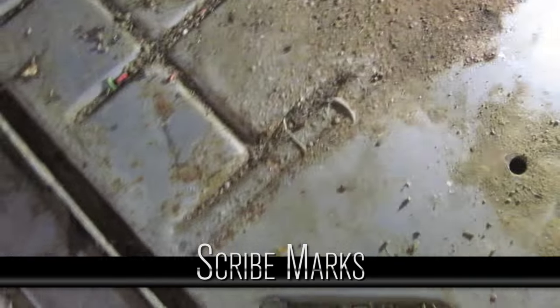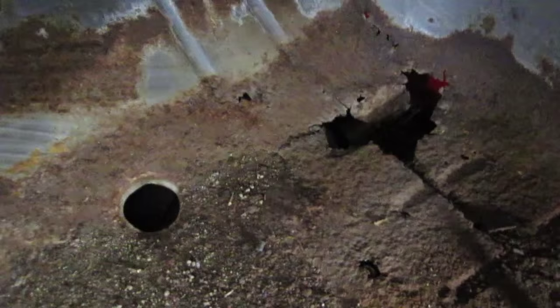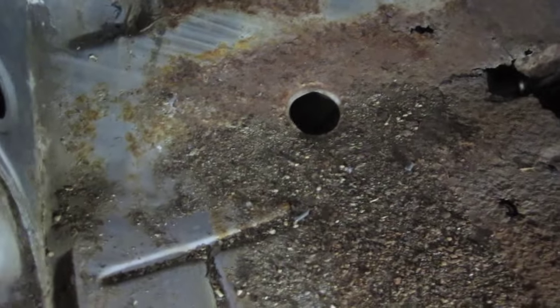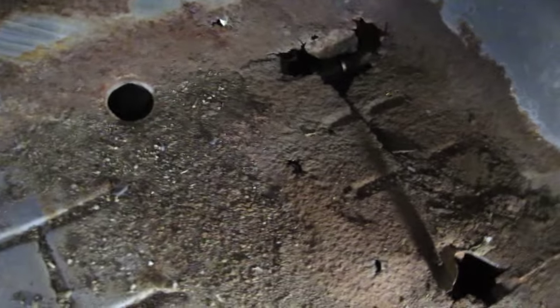I've got my scribe mark — it's kind of hard to see, but there is a scribe mark all the way around. You gotta cover up the seat — I've got an old fireman jacket — and make sure you cover up the windows and stuff. Spray that blanket with a little bit of water just for the sparks, and make sure you never leave that alone. I usually take it with me and throw it outside just in case — don't want fires.